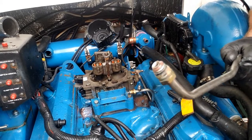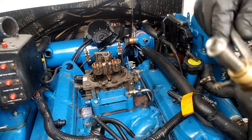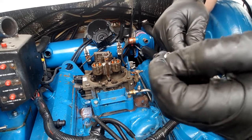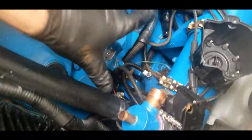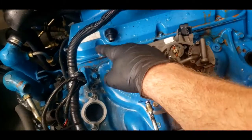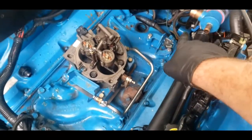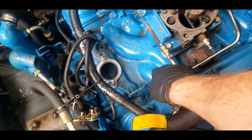When you're pulling these fuel lines off, make sure you look very carefully when pulling them out of the fittings — they have little o-rings on the end that seal the fuel from leaking out. The one on this end popped off when I was pulling it out of the fuel filter. Fortunately I found it sitting in the intake, so I can put it back on. With the wiring, I just zip-tied it off to the side far enough — distributor, coil, I've got a zip tie holding all that out of the way. The idea is just to keep this whole area free from anything that's going to keep this from lifting straight up off the top.